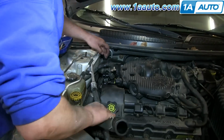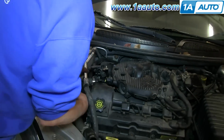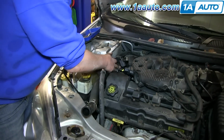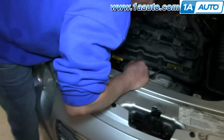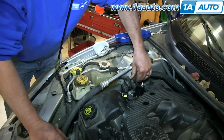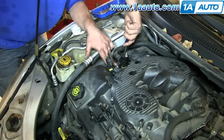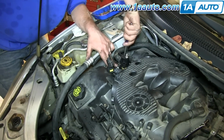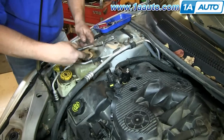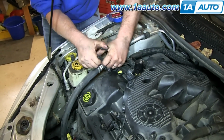And we'll kind of fast forward here as we put the hose back in place, the larger one. Just push it on, and then connect the radiator end, and also put the medium hose on. Position the clip in a way that you can easily get to it with the screwdriver, or if you have a pinch clamp, use the pliers to tighten that up. Clamp on the hose clamp for that second hose.